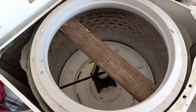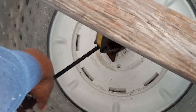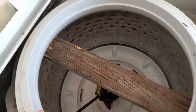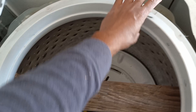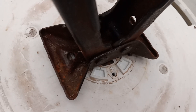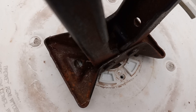The drum is jacked up all the way. You can see the scissor jack arm is almost touching the end of the drum — that's when you know you should stop, you don't want to damage it. Now you can take it from the piece of wood or grab it by the sides and lift it out. The drum basically pushes down on the transmission shaft and clears it, breaking that little seal that's holding it in place.